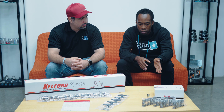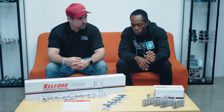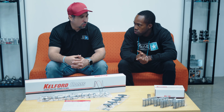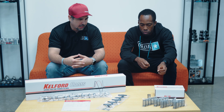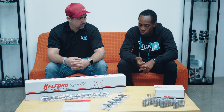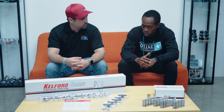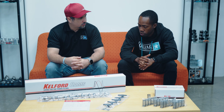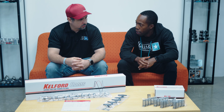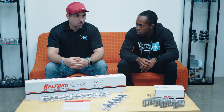So cams brought us to 950, and of course you have your springs and retainers. As far as the springs and retainers go, the spring rate is 104 pounds. There's only one set of springs — they suit both cams. All in all, the install was easy, the power was great because we did see a 100 horsepower difference, which we're going to go ahead and check out on the dyno sheets now.